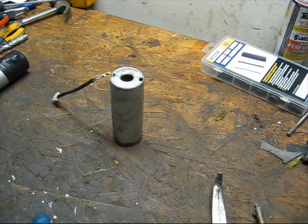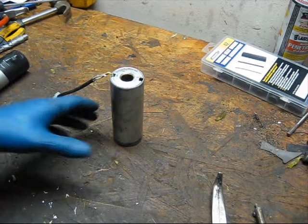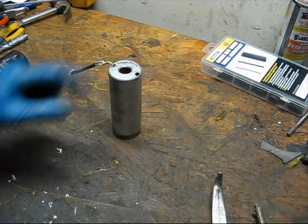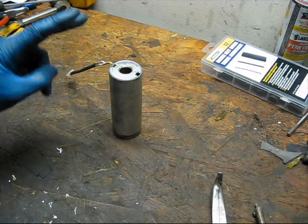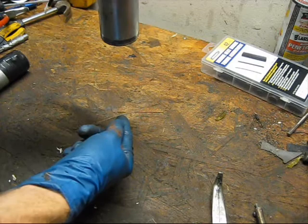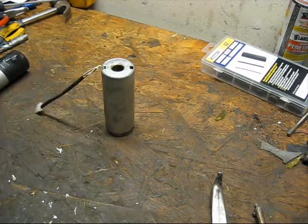After a while they decided that's not such a good idea, and they got away from that. What they did instead is they started using electronic solenoids, and that is what these are. This is a 24-volt solenoid. It runs on a 24-volt AC power supply inside the game, actuated by a number of heavy-duty relays. There are five of these inside the game, and these are what make the moles pop up. You apply a current to them, there's a shaft that sits down here, the magnet pulls the shaft up, and the moles pop up.